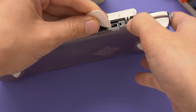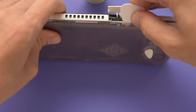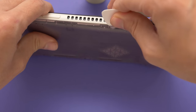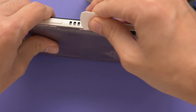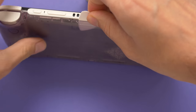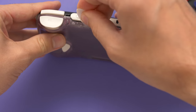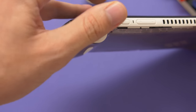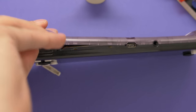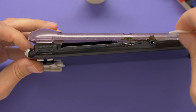This shell has clips in a few different places — four big clips on the top and four smaller ones on the bottom. A good starting point is opening up the SD card slot, and you should have enough space to pop your pry tool into the available gap. Once you are there, slowly work your way across to the other side, making sure not to apply too much force on the locking clips. When you get to the corner, gently twist your pick and the side clip should release on both ends. The bottom clips are a little annoying, but it's worth taking your time so you don't damage the edge of your shell.